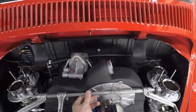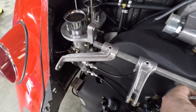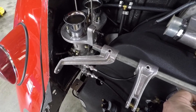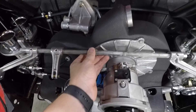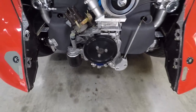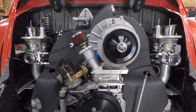What was really bad on this Type 4 is if you look from the top, you can see that these non-offset manifolds actually don't allow me to line the hex bar up at all. With it touching the shroud here, I am well off on the left hand side. So what I had done is made a little standoff bracket that moved that pivot point out about an inch and a half, and then I had to stand off the heim joint linkage down to the carburetor that same distance — which just brings in more trouble. So essentially I was fighting issues trying to get the geometry of all this stuff to match up. The advantage of going to this cable-type system is now I don't have to deal with matching the left and right geometry, and the offset of these manifolds doesn't cause any problems at all.